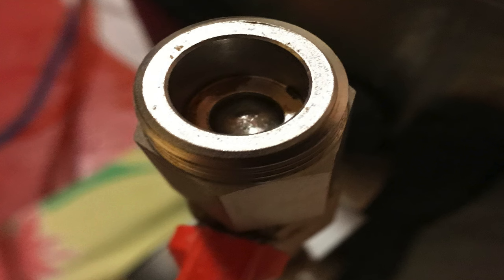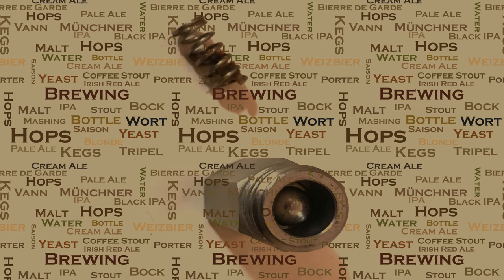While I'm waiting for this solution to heat up, I remove the part at the top of the recirculation pipe. In here you've got a spring and a ball, so be careful as they can jump out. What I do is give these a good blast out with a hose before reattaching them ready for the full cleaning process.